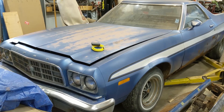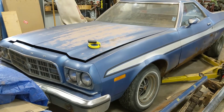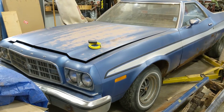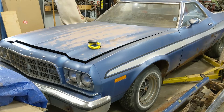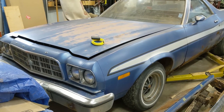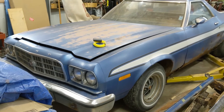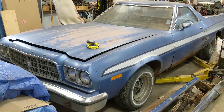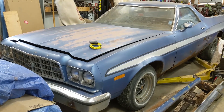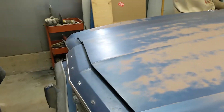I'm not pulling the heads off just for that because it doesn't mean that much to me — it is what it is. But for those that haven't been following the channel, this is a numbers matching engine. It's a 351 four-barrel with a four-speed transmission, so it is a four-bolt main engine. I did have the timing cover off, changed the timing chain when I first got it, and I took pictures of the mains — the front mains — and it's four-bolt main.